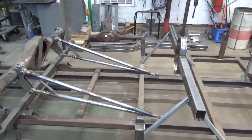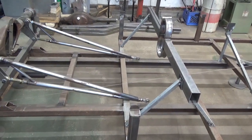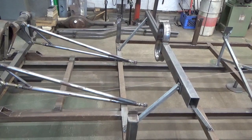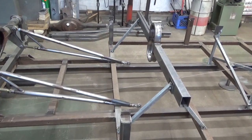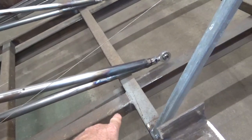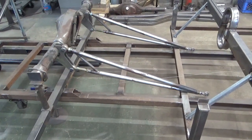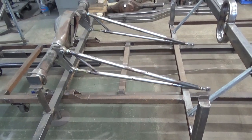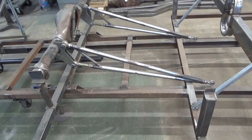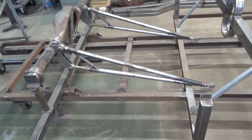Things not to do: you'll see guys building gassers with ladder bars that go all the way up to the front wheels, underneath the floorboards. That just doesn't work — it opens up the area for flex and you don't need that. Another thing I've seen is guys build ladder bars where the two bars are parallel and then the bottom one will kick up like in a hairpin or radius rod, like you'd see in a street rod. Those don't work either. Triangles are stronger than rectangles — that's what you have to remember. There are also guys using those old Chevelle flat stock ladder bars. Don't do that — you're wasting your time and money. They never worked on anything; they were junk from the get-go. People just thought they looked cool.